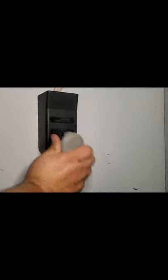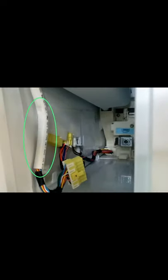So it is important that we unplug the refrigerator from the power source or flip the breaker off. Once you have that done, you need to separate the ice maker wire harness. This was a very tight fit, so I decided to use a screwdriver to help remove the clip. You may also want to loosen up the wire trunk that goes to the harness because it is a very snug fit. Just remember to put the harness back in its place when you reinstall the ice maker. Continuing on, we need to remove the screw holding in the ice maker's air conduit, which is held in by just one screw.